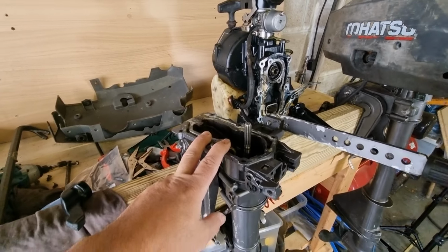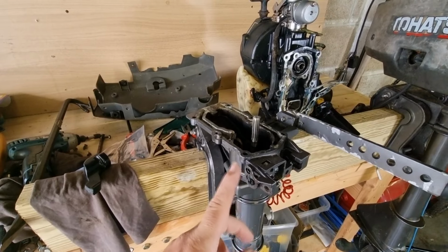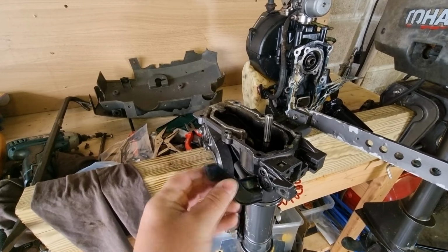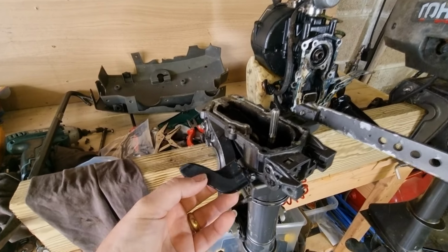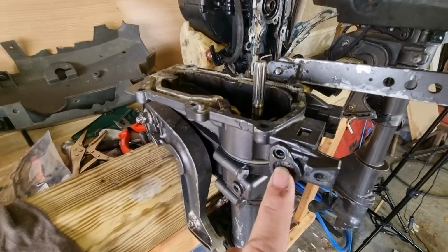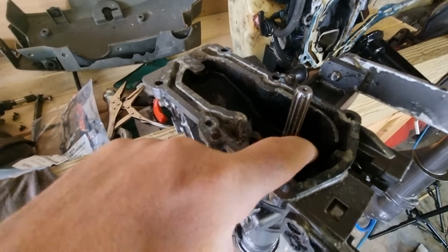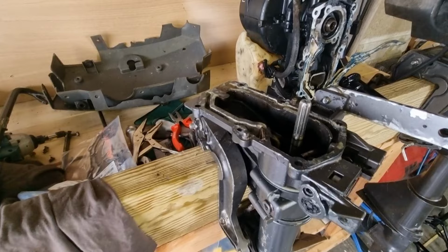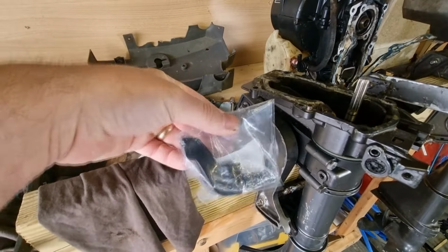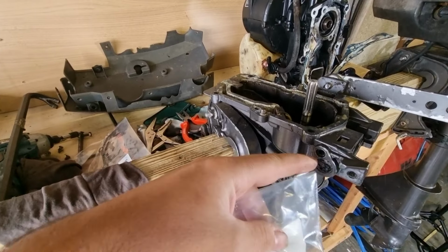As we know, the biggest issue that we found first of all was the gear selector was seized. It's still seized. I tried during the week to loosen it up and, well, you can see the handle came off. So I'm going to have to drill out the remainder without damaging the lever arm, which is in there. So that's going to be the next job. However, I have ordered in a new handle and here it is. So we'll get on today and drill that out and have a look.